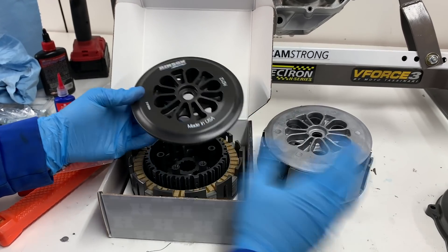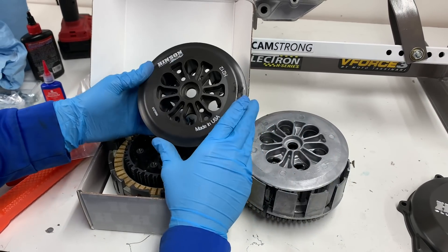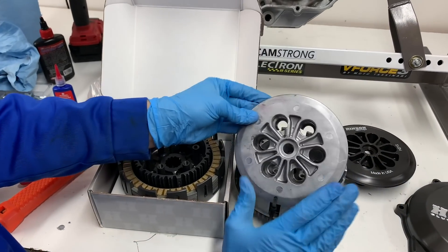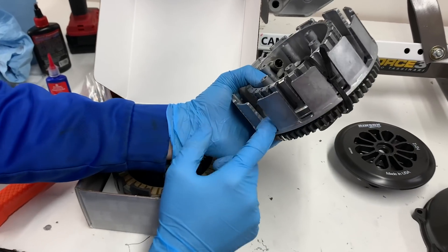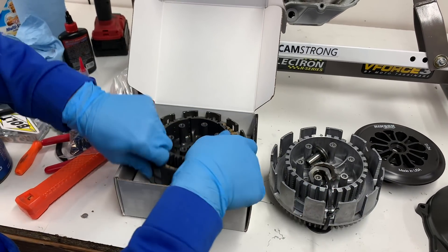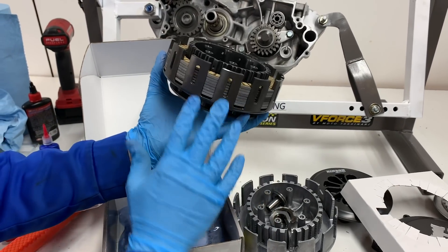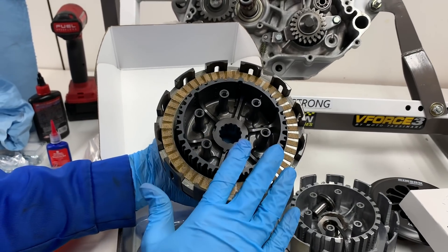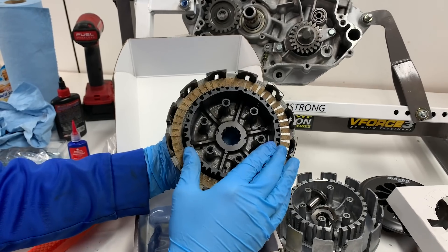Just looking at this pressure plate here and comparing it to the stock one, you can see how much ingenuity went into making this Hinson one. It's all coated, not just bare aluminum, and it is super strong and durable. You can see there are extra oiling holes here to keep your clutch a lot cooler, which will extend the life of it — not included on the stock one. The stock clutch basket has deep grooves in it which actually affect the plates moving up and down. The Hinson basket is way stronger and won't do that. There are also extra oiling ports on the sides of the basket, and little lines to keep the oil in the clutch. This clutch is super precisely machined, which gives you a really responsive and precise clutch that stays cool and lasts a long time.